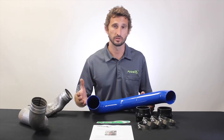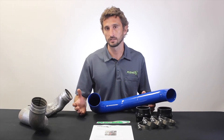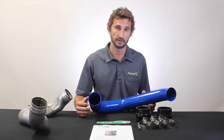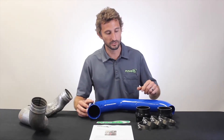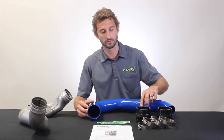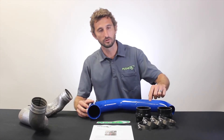These trucks come with a small set of compound turbos which make pretty good boost with a good tune. The other convenient thing is that the intercooler outlet and the factory intake manifold inlet have external beads, so by switching to this you reinforce that area of the system. Because of that switch, it's required to go to a different style coupler than the factory couplers, so this setup comes with two heavy-duty couplers and four new stainless clamps.